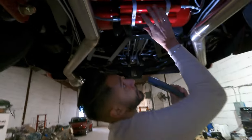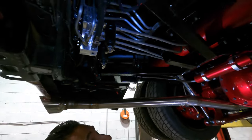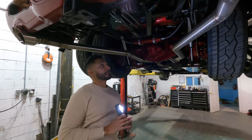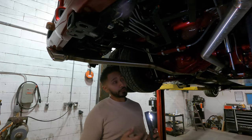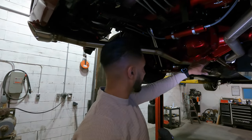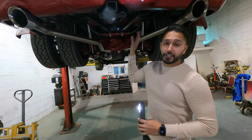For the air ride, we have four ViAir 485 compressors running an AirLift 3H management with height sensors on the control arms. We did all the hard lines in brushed aluminum — aluminum lines, tested everything to make sure nothing leaked, then brushed every single line and hit it with a clear coat so it doesn't oxidize. It matches the rims. All of that runs to the bags in the back and to the front, all nice and symmetrical. That was a big thing for us — it's extremely hard to do a symmetrical airline setup with the AirLift. James made a custom block and manifold that distributes everything so it all looks equal.